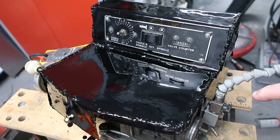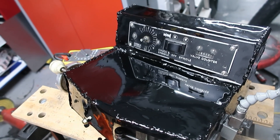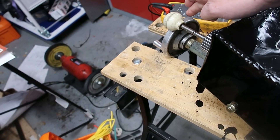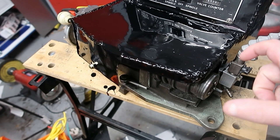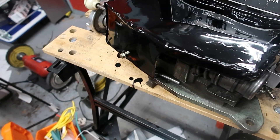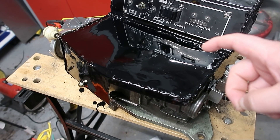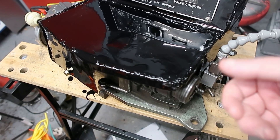The chap who owns this says he uses that quite a bit when building Subaru engines and other high performance engines. Going to the other end of the control, we've got the big grinding wheel running and also the chuck running so the valve's turning as well. You just move the valve in and out using this wheel. The chuck is a pneumatic chuck - there are sets of ball bearings inside which open up when you apply air pressure, you fit your spindle, then take the air pressure off and it grips the valve. He says this is his much preferred valve grinder because the others require you to keep changing the collet size depending on the valve, whereas this is much easier to use.